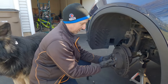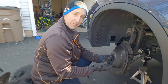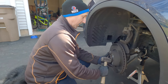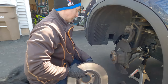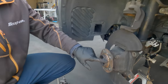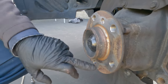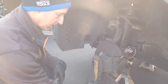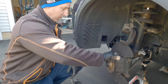It's not typical for the rotor to just fall off — this is the original brake rotor, so for it to come off like that is pretty crazy. Normally since you're not reusing it, you can tap around the hat or tap on the backside to free it. You can see this hub has been taken care of — there's a light layer of grease on the outside so it didn't build up a lot of corrosion. I still want to remove any surface rust with a wire brush.